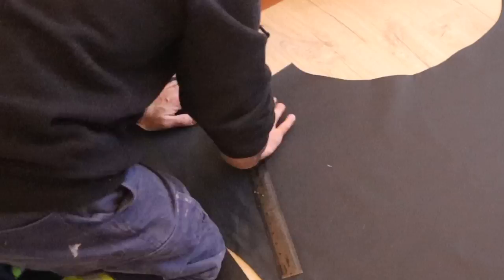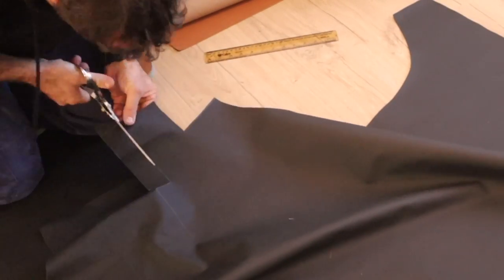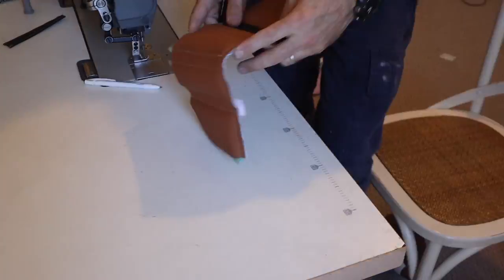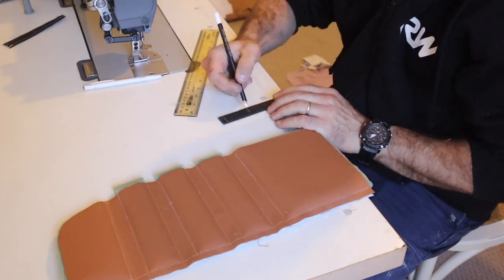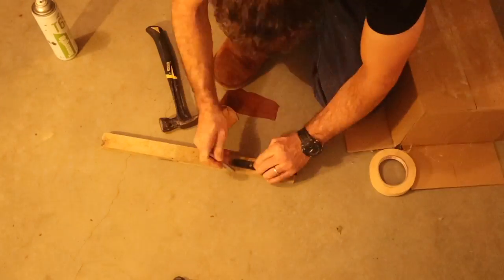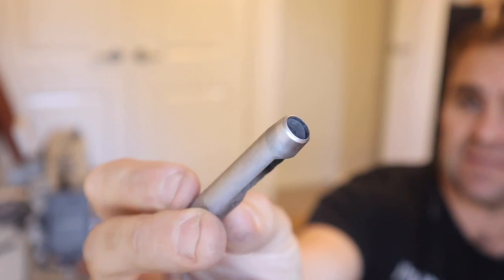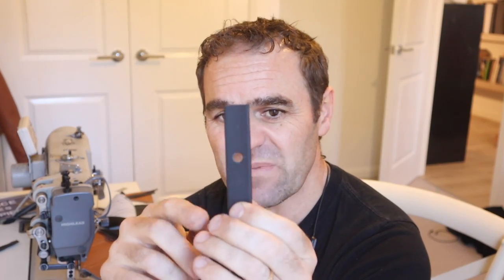This is some very nice and very expensive black Ferrari leather that I'm using for these strips. You can see I'm gluing the back of them and then folding them into the center on the back, and now using an 8-millimeter punch to punch the holes out at a nice even spacing. Here is my first Daytona stripe strip — punched out with the holes using just an 8-mil punch. These things are readily available and relatively cheap.